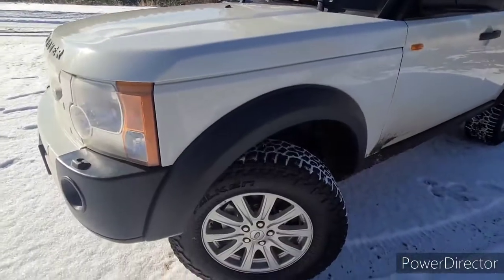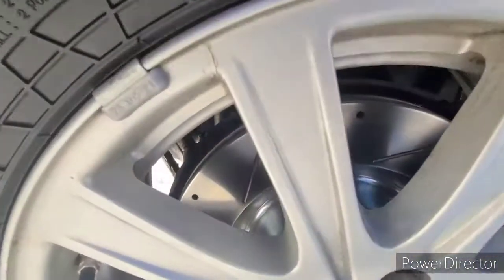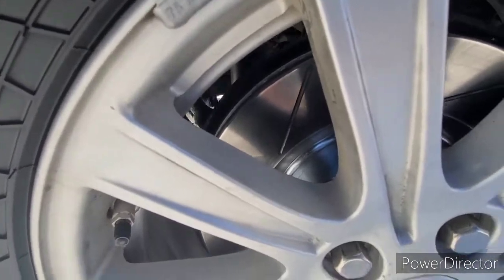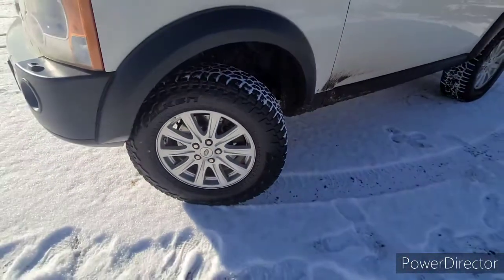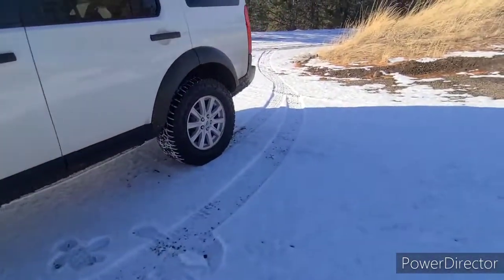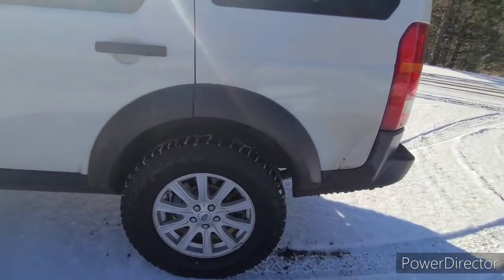The lift was super easy to put on. We also noticed when driving that you could feel a little shake when hitting the brakes, so we ordered some Power Stop slotted and drilled rotors and pads for the front. The wife and I put those on two weekends ago — took care of that warped rotor that was causing the shake. We'll end up doing the rear as well with time.